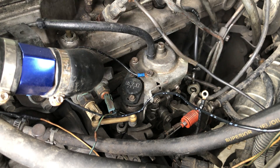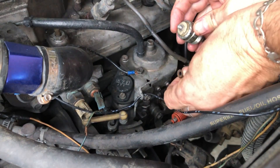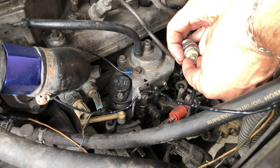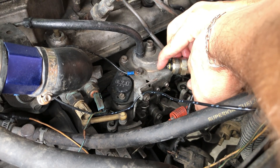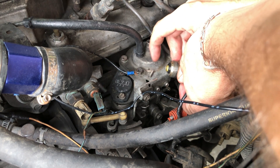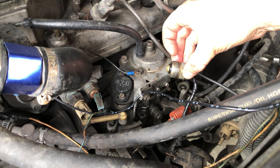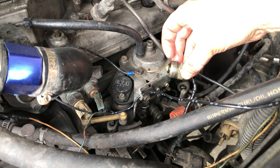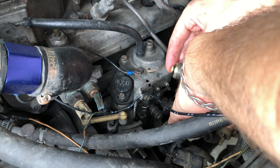I'm going to test the old one to see if the magnetic part is working. Here's the wire that goes to the ignition — this is what powers the magnets. I'm going to touch the housing here. Okay, so you can see — well, that's how it works. That's safely between the injector pump and the engine block, right where it belongs. That's how that works — so the magnetic part was working; the plunger is damaged.